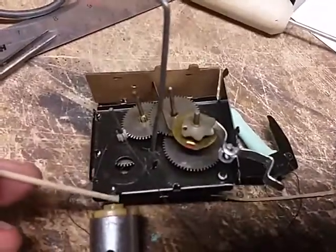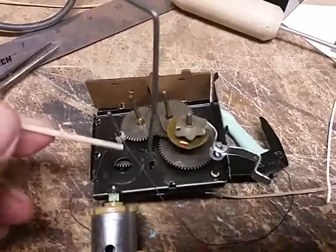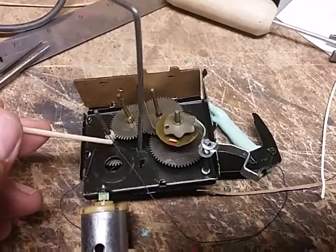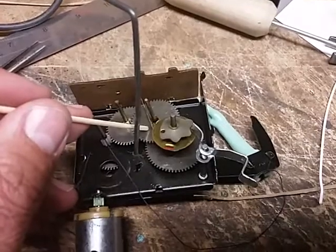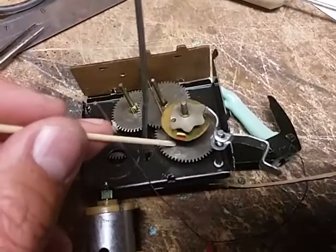You've got the motor with the pinion. From this angle that goes counterclockwise. It drives this gear which goes clockwise, which has this pinion on it going clockwise, driving this reduction gear counterclockwise, driving this reduction gear clockwise, driving this final reduction gear counterclockwise.